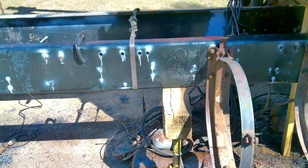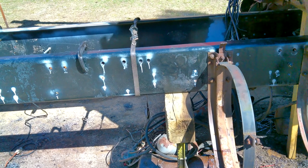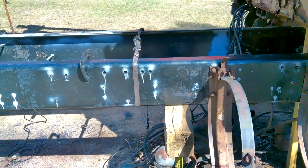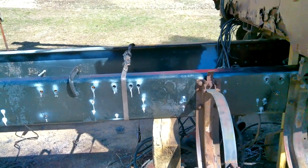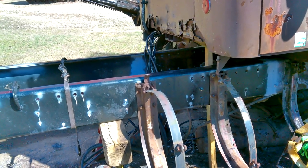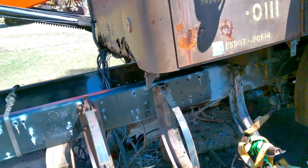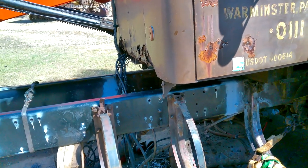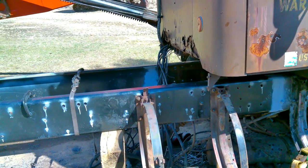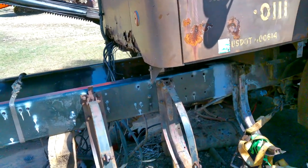I broke my 9/16 bit. I'm going a 1/16 over on all the holes, so there's a little bit of play. That's the way it would have been if I ordered them from PG Adams or, what's the other name of the company? It starts with a V. Vicon or something like that. They would have been a 16th over. So they're all half inch and 5/8 bolts.